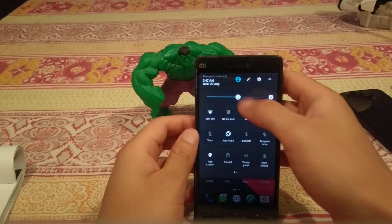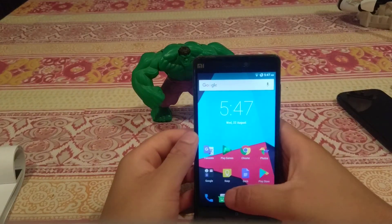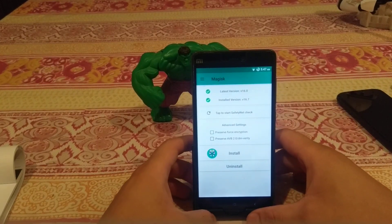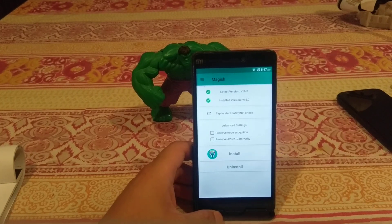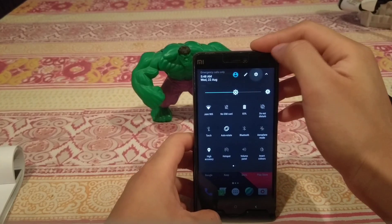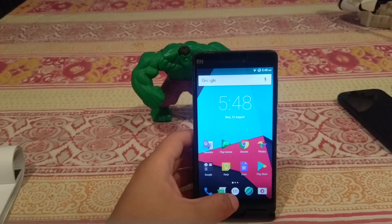Apart from that, you have inverted colors and something called ambient display, which is really cool. Since this is a custom ROM, it wouldn't be complete without talking about rooting. I tend to use Magisk because systemless rooting is a much more elegant way of doing it - you can pass SafetyNet checks without losing any root functionality, and you also get Magisk modules. There's also live display, which reduces blue light and gives the phone warmer tones at night to help you sleep more easily.